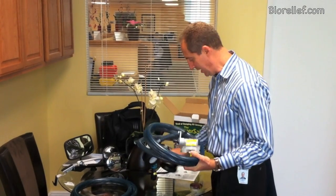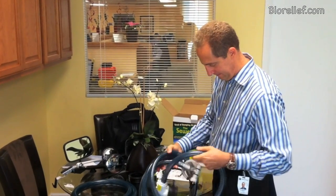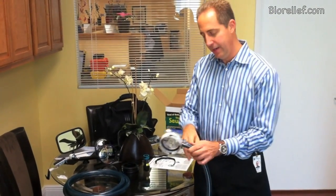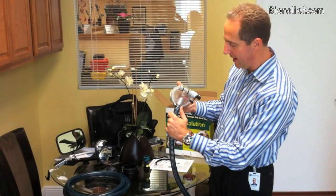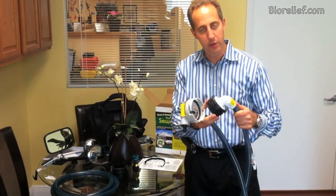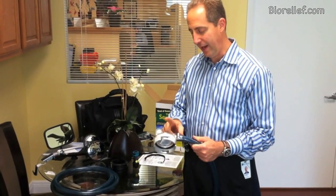The way this thing works — and I'll show you how it hooks up in a minute — this here is the Sewer Solution on this part, and you can see it has a clear end so you can see when your sewer is cleaned out and not. This part over here gets connected to the sewer; it goes right into your sewer and it has a little donut adapter right here to go into the sewer hole. And then over here, this gets attached to your trailer, to your black tank clean-out.